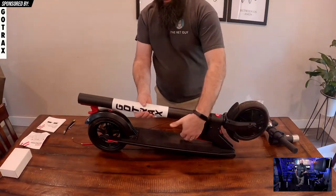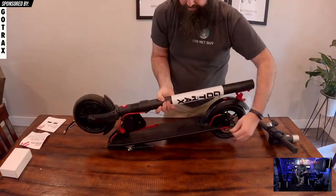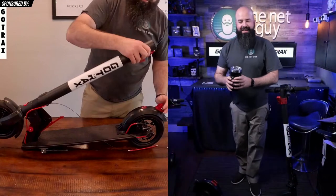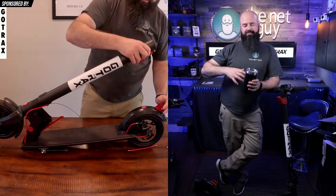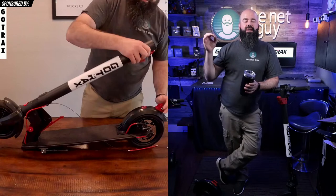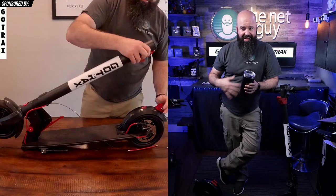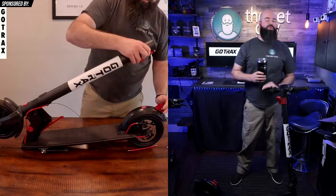I pulled out earlier and I showed you the Allen wrench that it comes with and the little tire filler extension. Now, that's important, the tire filler extension. I did not think about this, and I didn't actually do, sadly, the work that was needed until afterward, but make sure your tire pressures are up. This thing is going through many different heat ranges and humidity and all that. And once I inflated the tires a little bit more, get them back up to 50, they ran really, really good. If you have the tires down a little bit, it's going to be a softer ride. But again, for me, when I need the extra weight carrying capacity, get it right up to the 50 PSI or whatever's printed on the tire.